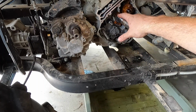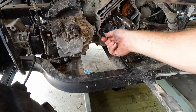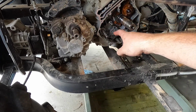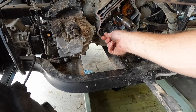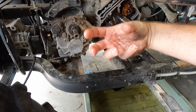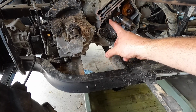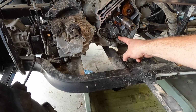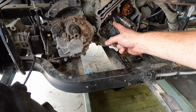So you have the one that runs off the crank, which is the idler gear, which spins this rod on a plastic gear that runs through to the water pump side, which has a plastic gear on the inside of the motor. If that fails, you have to pull the motor with the cases to replace that. And then it runs all the way across to the water pump, and on the back of the water pump, you guys saw it has another gear on there. So there's multiple places for your water pump to fail. It could be the impeller, it could be the seals, it could be, let's hope this gear here doesn't fail, because then your oil pump quits spinning, and then you're gonna have an issue with blown up motor, locked up bottom end because you're not getting any oil pressure.